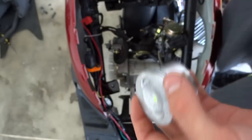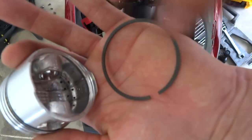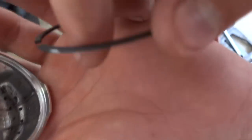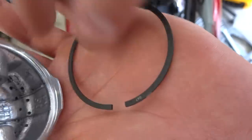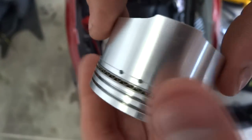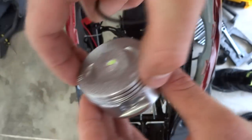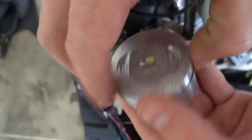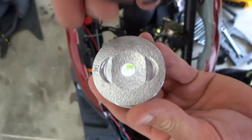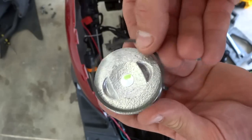Now install the second oil ring. If the rings have numbers, put the numbers on top for reference. Find where the gaps are — there's a gap there and a gap there — now go in the middle of it. For exhaust and intake, put them parallel — half and half. Here's one here and put this one like this, then the other ring opposite of it.